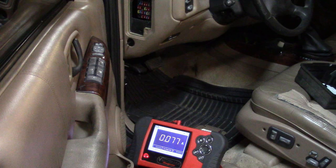Here's the mistake a lot of people are going to make: often pulling this fuse does not change the amperage draw. The reason is that the people did not wire the radio through the radio circuit. So just because you pull that fuse and don't see the amperage drop, that doesn't mean you can rule out the radio — usually it's just the opposite. Obviously, we have a confirmed problem with this aftermarket system wired on the correct circuit, so this is going to take some hunting and detective work.